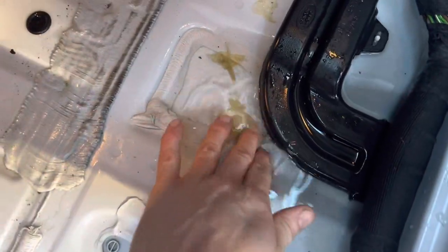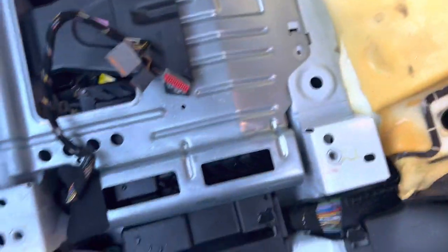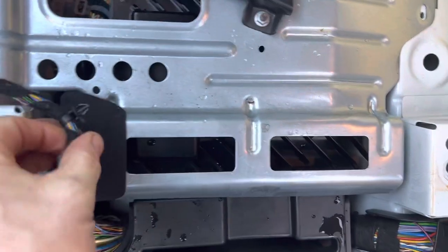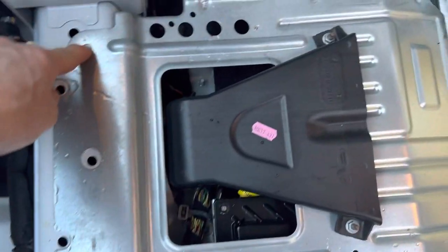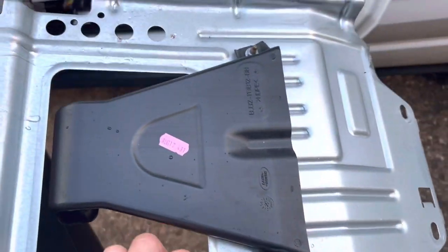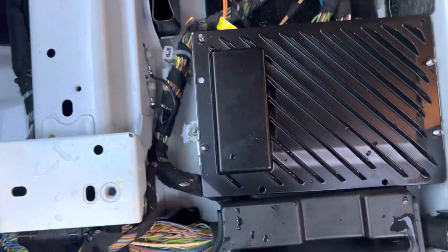You can see we've got a little goldfish bowl going on in there. The back section of the carpet you can just lift up out of the way. Then there'll be one little clip there - pop that off. As you can see all the wiring and everything is quite wet. Four 10mm bolts hold this little plate on, so pop that off. You don't need to remove that air vent - put that down there for safe keeping.